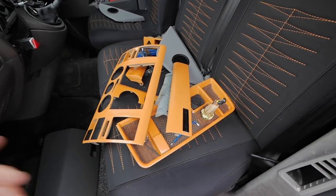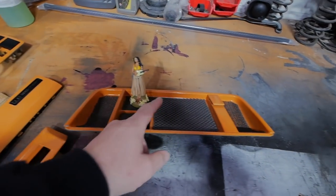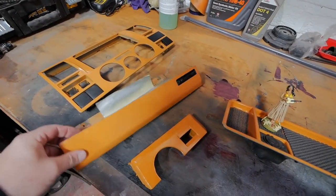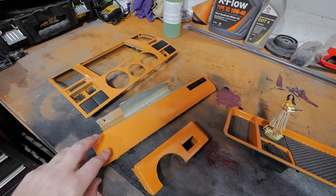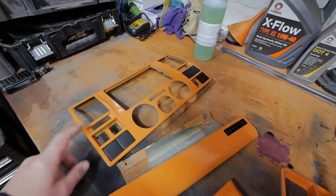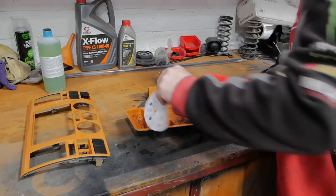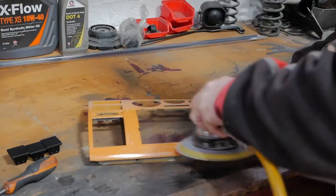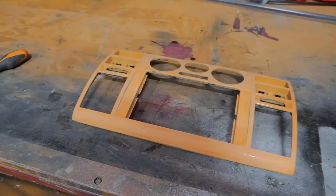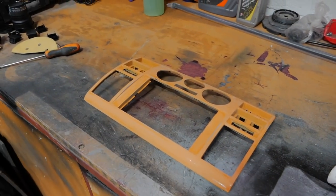So there's a pile of trims — let's get those inside and get them ready. I'll push all these blanks out, take all this stuff off, and then give it a quick sand to rough it all up. Normally these are just plastic, so you'd have to rough it up, sand it, and then give it some plastic primer. I don't need to because they're already painted, so I can rough this up and then we'll just paint straight over it with black. This one needs painting black — I've already started those ones over there, they just need a few more coats, then we'll get them all black and ready for dipping.